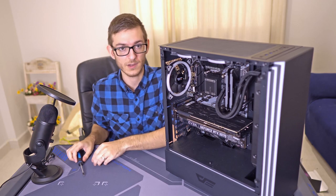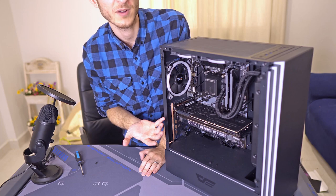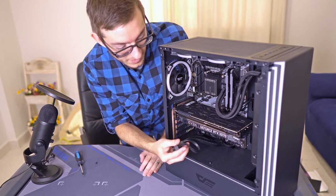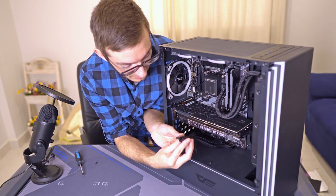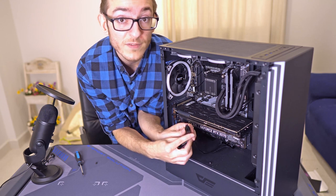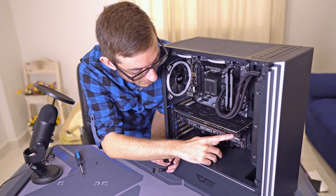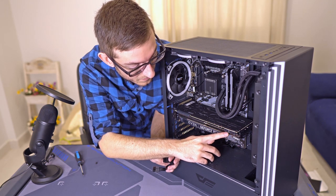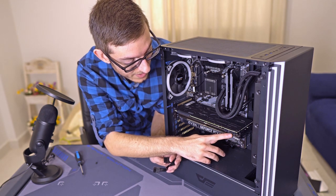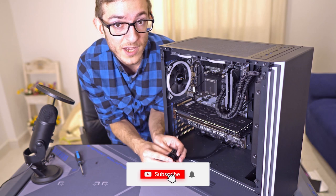Okay, now that it's secure — how do you hook it up to the power supply unit? Well, that's really easy. You'll see these two cables. Depending on your power supply, you have to check — do some Googling on that. Make sure you have a power supply that has these type of plugs: PCIe Express. You have an 8-pin and a 6-pin, so make sure the specs of your power supply mention that.